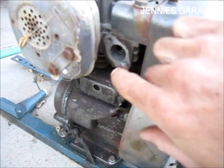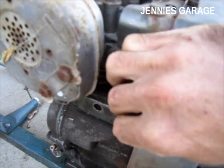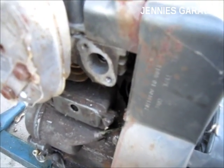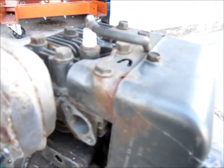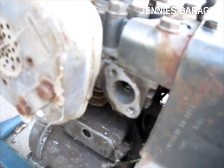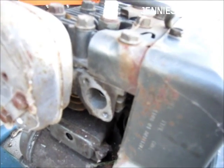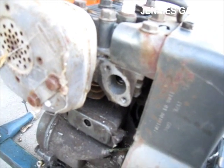I'm not just going to leave this wide open, because that would mean that if I did get it to run, it would be running at the equivalent of wide open throttle, ungoverned. I don't want to do that because it'd be really loud and the engine would probably shake real bad — it'd be going probably 4,000 RPM, which is pretty fast for these engines.